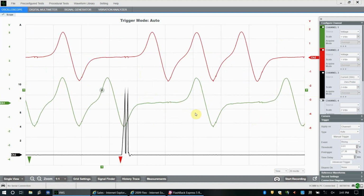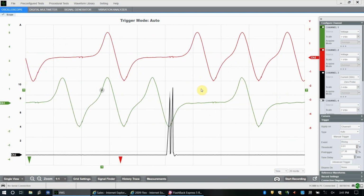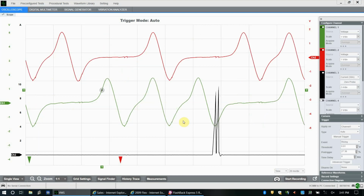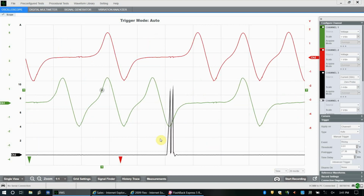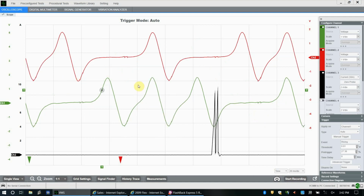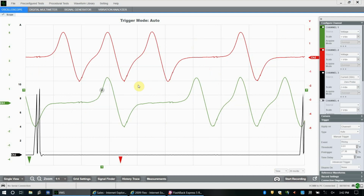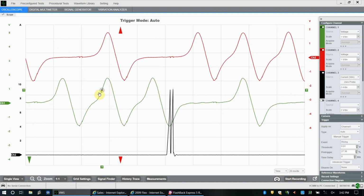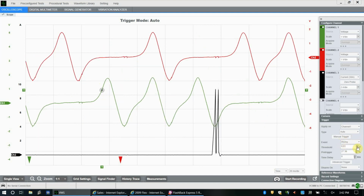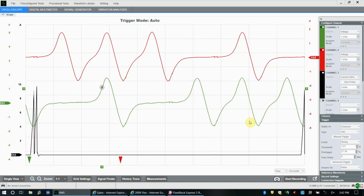1-ish volts? 0.91 volts, sure. So here you can see now we're triggering on the VRS pattern, and it's not as nice because this number 6 here is still moving by, right? And the reason for this is, if you look at the pattern, can everybody see that? As you're moving, we're telling it to trigger on 1 volt. It was 0.91, let's move it up to 1.